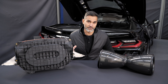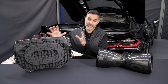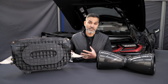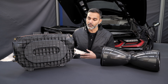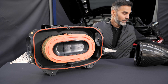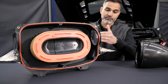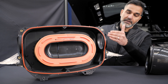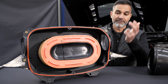With the airflow having moved through the flexible sections, it's now entering into the main filtration area. I've got in front of me the main central airbox with the filter inside, and the Eventuri main airbox section. Let's start with the stock airbox first, which is very cuboid in nature. If I take the front panel off, you can see the stock filter is cylindrical in shape. Airflow enters through the side openings here, into that chamber and then through the filter, and then 90 degrees out through the back of the airbox into the MAF tube.